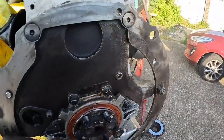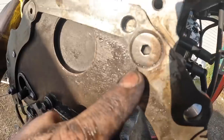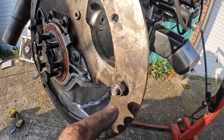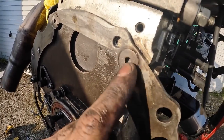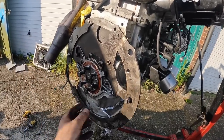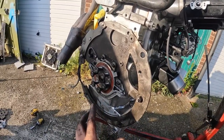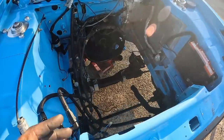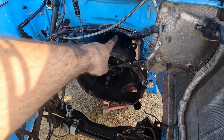While putting the nuts and bolts back onto the adapter plate, I noticed another issue — the adapter plate is cracked in two places, essentially in two pieces. There are no other cracks around it, and I'd like to think that because it's in the correct position due to the dowels and still being held down, that crack isn't a major issue. But I'll get in touch with the company that supplied it to ask if that crack could potentially cause the gearbox to be out of alignment.